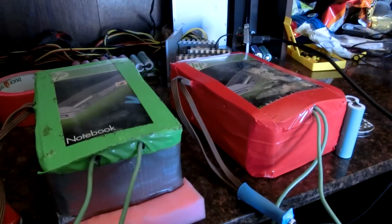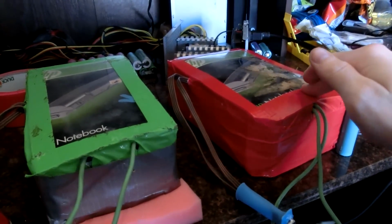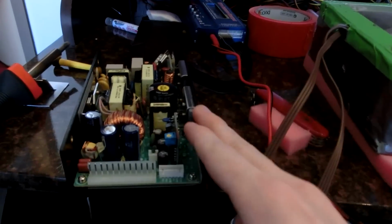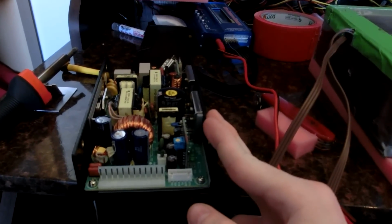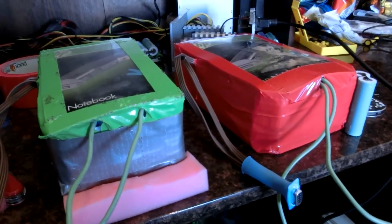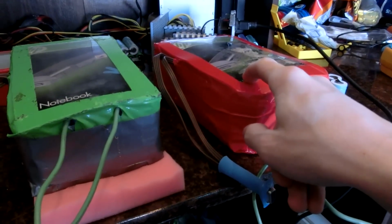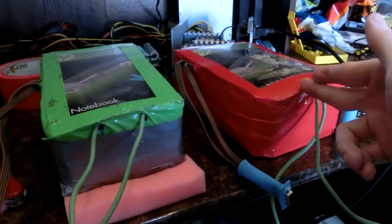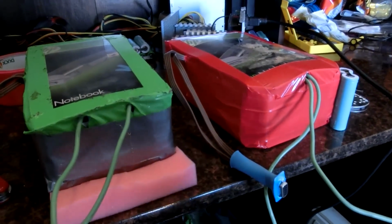The battery went down to 43 volts, and I was thinking all 12 packs were in series, so that would mean that the batteries are almost near dead. So what I did was I went ahead and put together my onboard charger, and I tried charging it, but it took a lot of power and took a lot of time to even get it to 48 volts. Turns out I was overcharging it by 150%. Somehow, the cells got to 4.45 volts, but 4.45 times 12 is not 48. It's more like 53 or 54 or something like that. So it was so confusing.